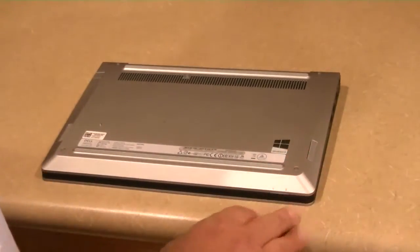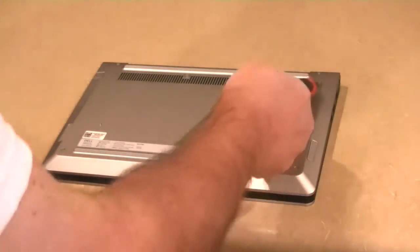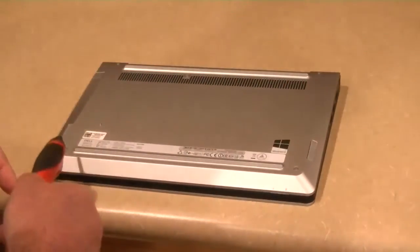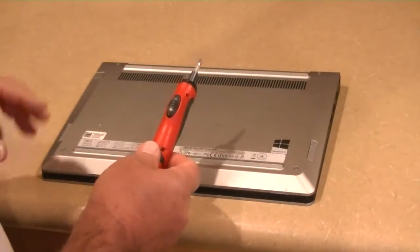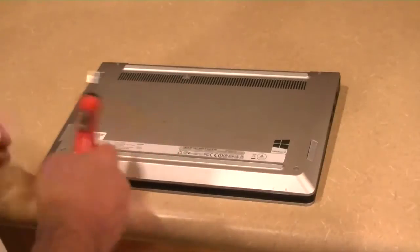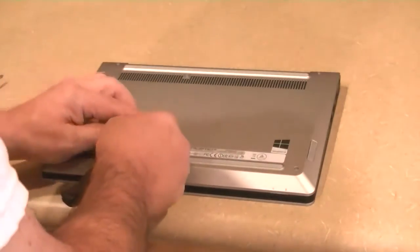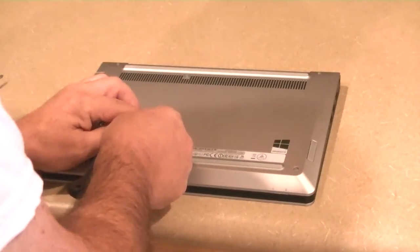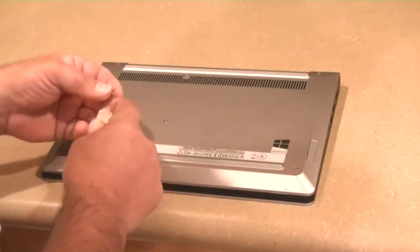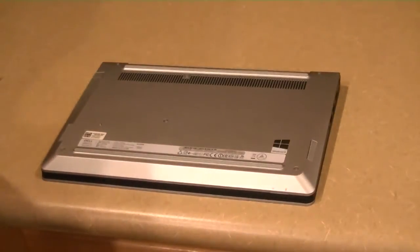What we need to do is remove the screws around the perimeter. I have a little electric screwdriver that doesn't apply a lot of torque, so it's great for working on computers — it goes forward and backwards. We need to remove these two stickers first, peel those off, and now we have a screw visible there that we need to take off.